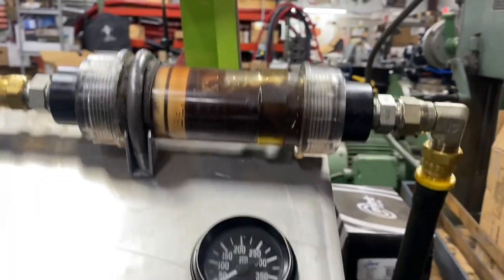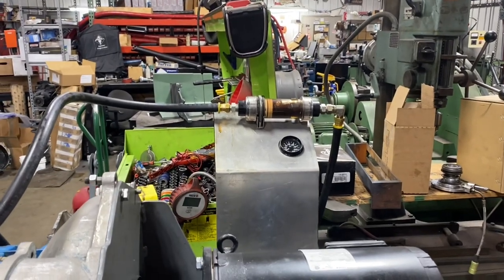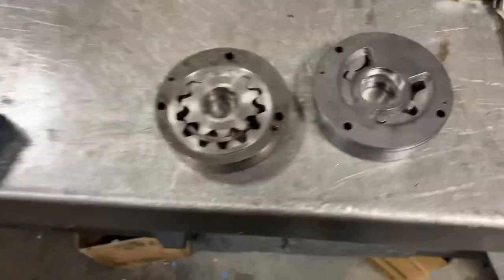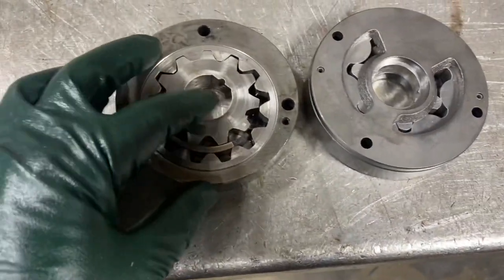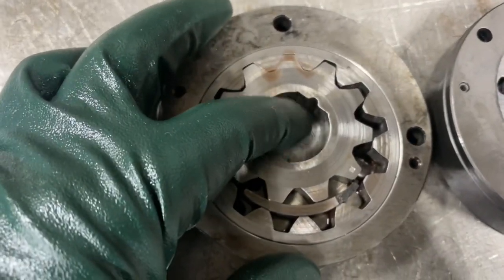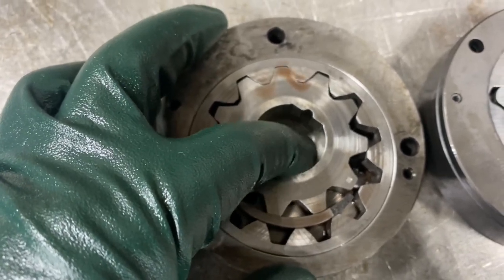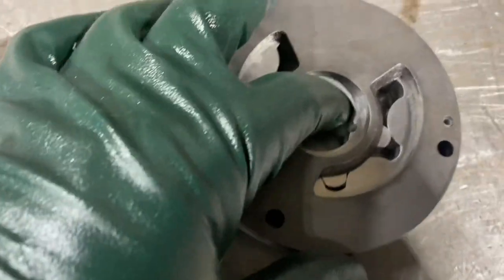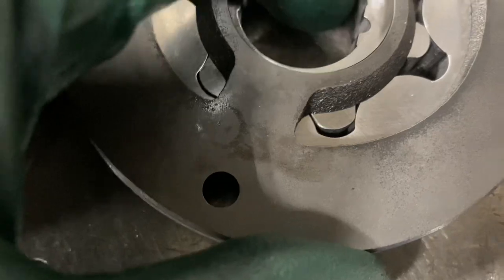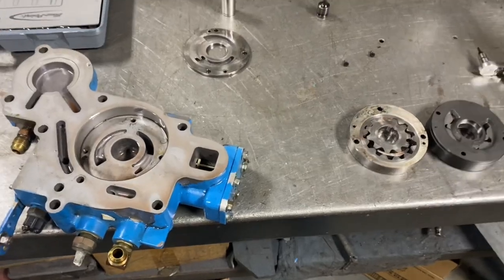This has a failed pump. We're going to put a new pump in it and recheck it. I took the pump off, and what I noticed is this is the old style pump with more teeth — look at the clearance between the gland. That's a lot. Over here with the new one, you see how it barely moves. So we're going to slap a new pump in there and get our cooler flow back up to snuff.